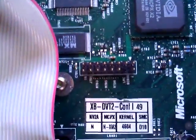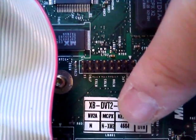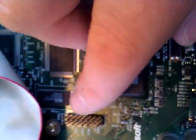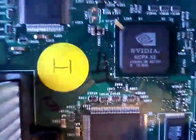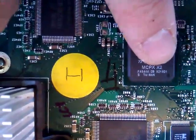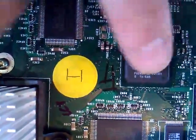It's got a little information tag down here, the same kind of thing as on the outside. It talks about the kernel and some other information I'm not entirely sure about. It's got the pinout header here that some people would add to their retail consoles to connect the modchip. And for those who know a bit more about these consoles, you can see that this is the MCPX 2 — what's significant about that is that retail consoles had a 3. All the debug consoles have the 2.